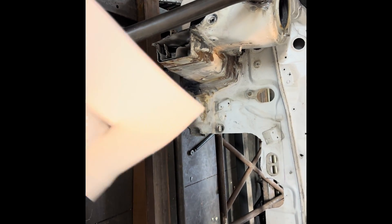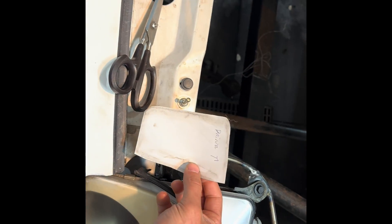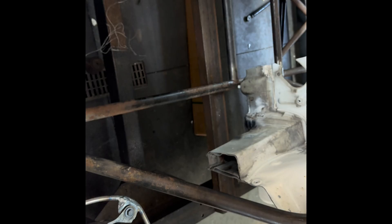So I started cutting these templates. Maybe not everyone knows this little simple trick: take a piece of paper, press it up against there, and then you take a dirty finger or thumb and rub it around on the paper, and now you have a template. Then you take this, trace it to metal, cut it out, trim it, fit it, weld it. Pretty easy.